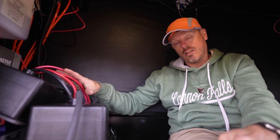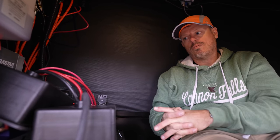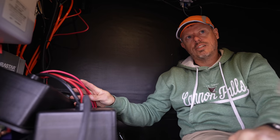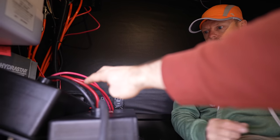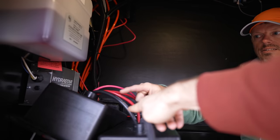Everything factory is fine as long as you don't have a big inverter — 2,000 watts and above would require larger wiring. With just a fridge inverter around 1,500 watts, you're probably okay. Mike reused most of the existing wiring, only adding what's needed for the shunt. Mike is now wiring up the BMV 712 — the power coming off the negative side of the battery bank goes to the shunt where measurement takes place, and then connects to the existing negative wires from the original batteries.